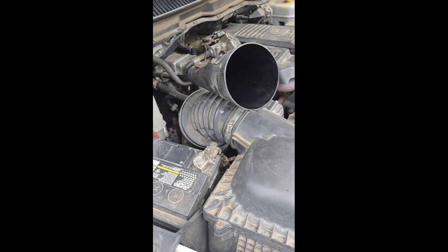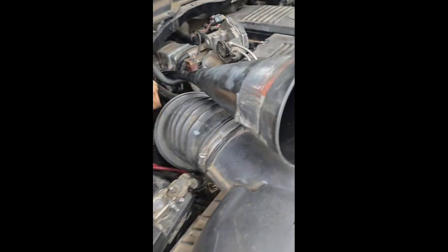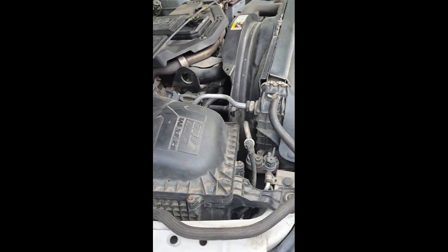Okay, now we're back, and so far so good. I went around and checked, and I don't have any leaks, which is a good thing. So that means the gasket is holding. When I checked the fluid, it was just shy of one of the hot dots. The hot dots is 2 dots. Top dot is, what did I do with the paper? Piece of paper. So I added the little that I had from one last quart, and then I'm gonna put this stick in there and recheck it again.